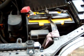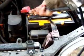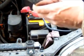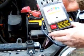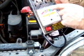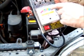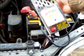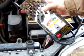Inside this battery tester is something similar to what an electric heater would have in it. When you hit the load test button, it puts a big draw on the battery — that's how you test it. You want to note it's 12 volts here, just a little over 12 volts — that's good. If you hook it up and it's already down to 11 or so, you're low to start with. Also, if your battery was dead and you've been driving the car, you can get a different reading after you've charged it.